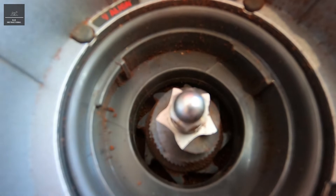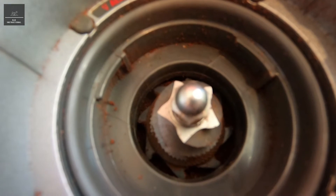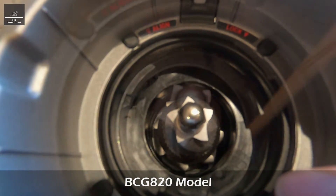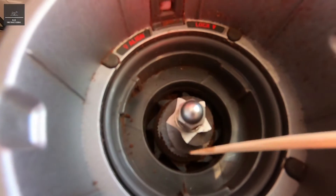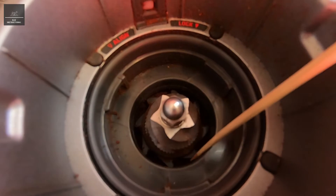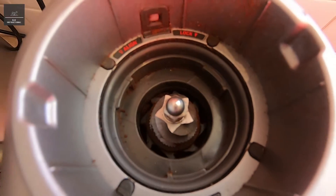There's a black impeller blade just in there — that guy there. I believe that's what's worn. It is a common thing on these models. On the newer one, which is the 820, that is actually a stainless steel gear, but I think this one is some sort of plastic, like a nylon of some sort. So we'll take it out and have a look — it could be that something has jammed, or that this impeller blade has worn. We'll only find out once we open it.